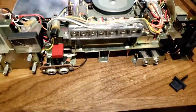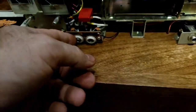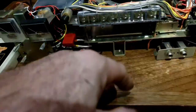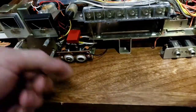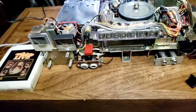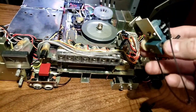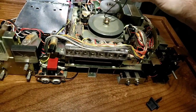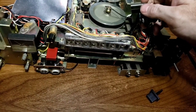This is a kind of unique unit because all the front inputs are mic inputs and a headphone — it's got front and rear. All this stuff actually screws directly to the face plate, so you take the face off including the counter. I've got the counter belt, so the counter belt goes on here, and then when this is hooked to the face, this belt simply hooks onto here and wraps around the plastic pulley for the counter.